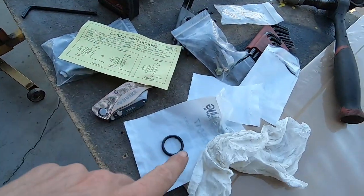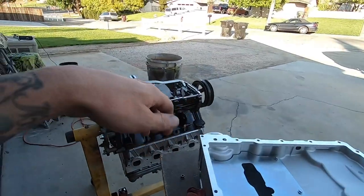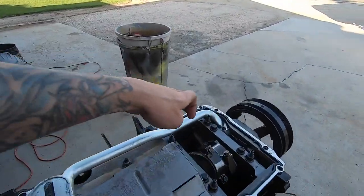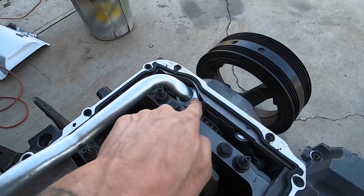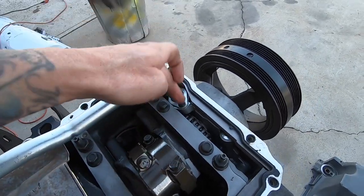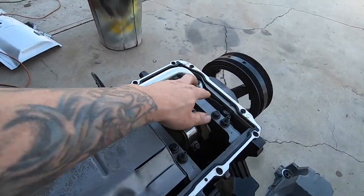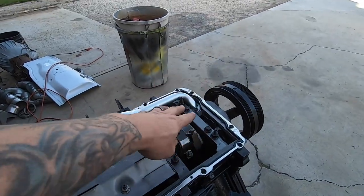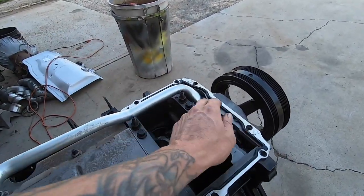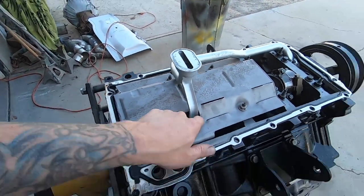So I went with the green O-ring, put a little bit of grease around it, greased it up, greased the pump, and then we slid it in. It took some effort, but it goes in. And then now we've got the safety of both bolts and a little touch of red Loctite on these, snug them down. This should be rock and roll. And then you always want to tighten this first before you hit this guy. That way this is seated and it doesn't obviously screw it up. If you have this locked down, you could have issues with it seating properly. So these are locked down in place. Got these guys all done. We'll just slam this guy home here.